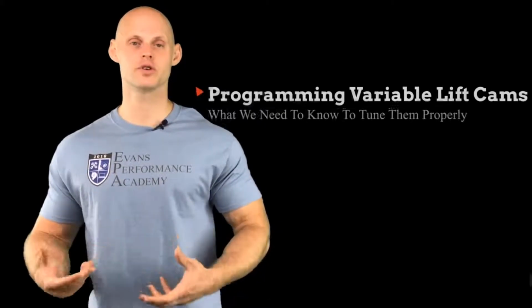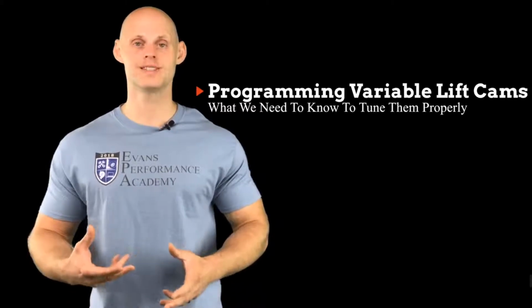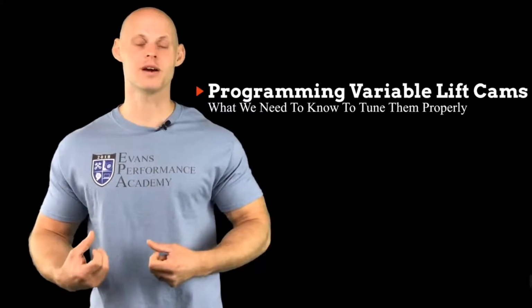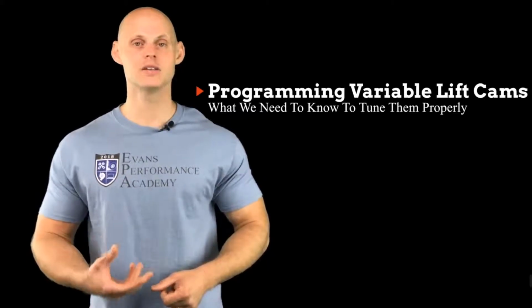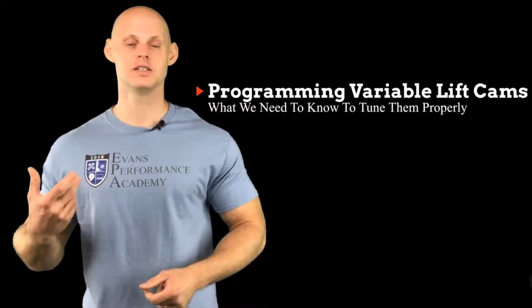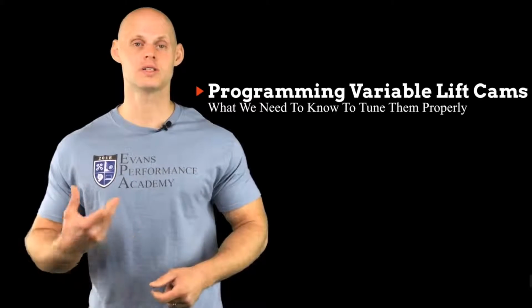Okay, so now that we understand how our variable valve lift timing system works mechanically, let's move into the virtual or programming side of things so we understand how we're going to be controlling it and how we're going to be actually tuning with this system. Because we have two distinct sets of profiles on our camshaft, we're going to have two different deliveries of air mass coming into our engine, and therefore a completely different amount of fuel mass that has to be delivered. And because the overlap and the duration are going to change on our high cam profile, that's going to change the dynamic compression ratio and therefore change the timing demand, or spark timing, on our same engine.